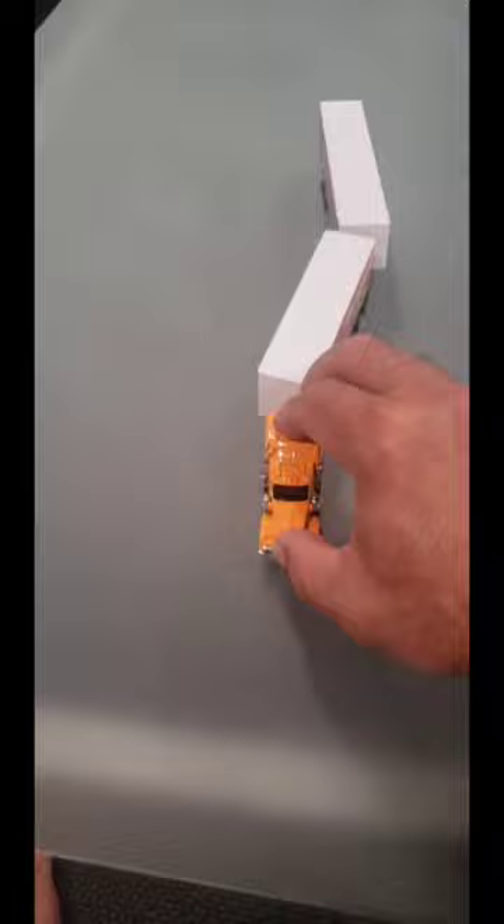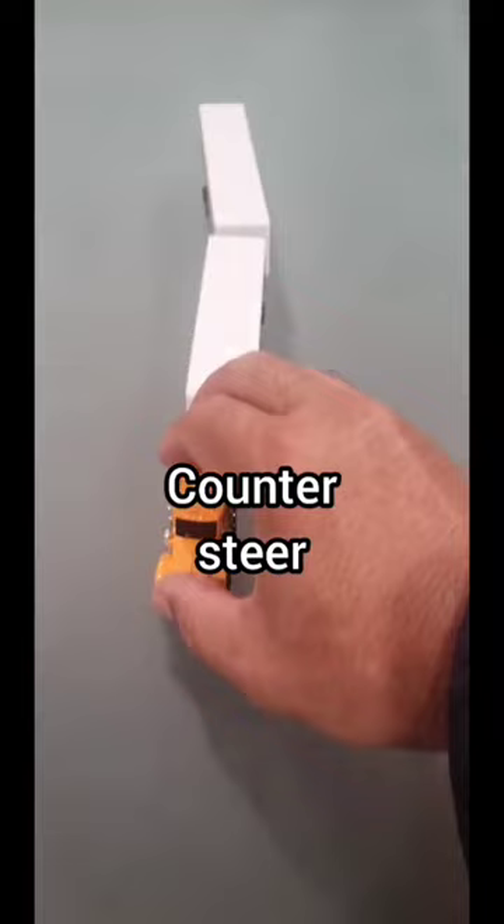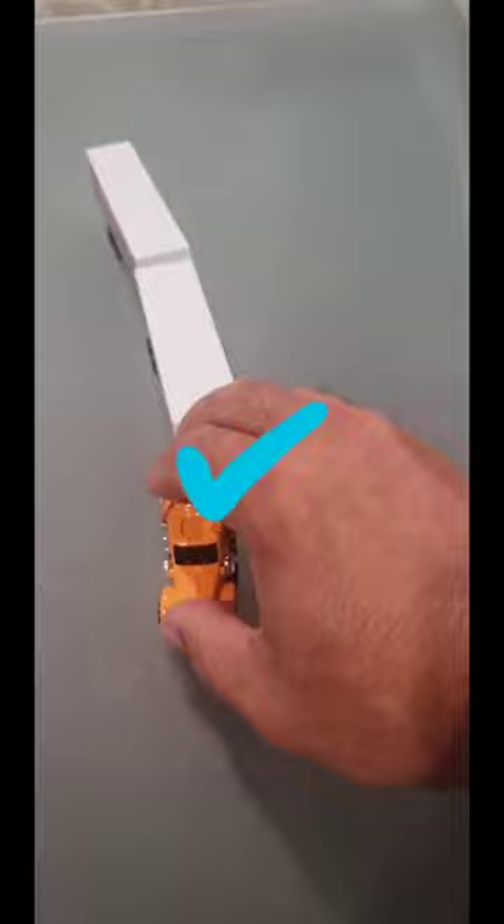So this time I'm going to do the same thing, but this time I'm going to counter-steer and make that first trailer straight with the second trailer. And remember to think of that first trailer as a long drawbar — a 20-foot drawbar.